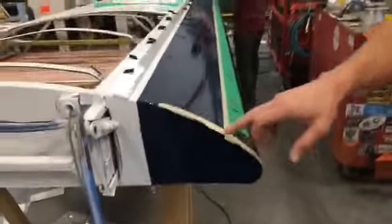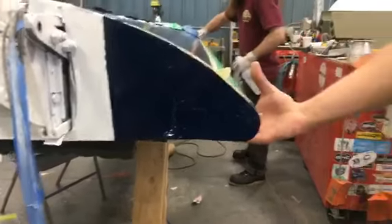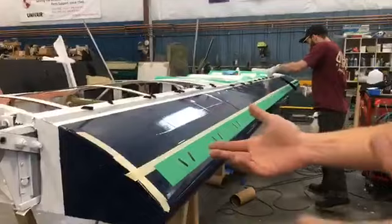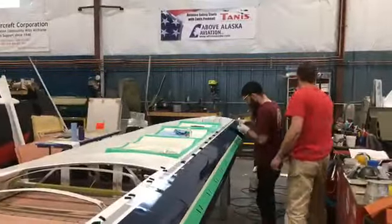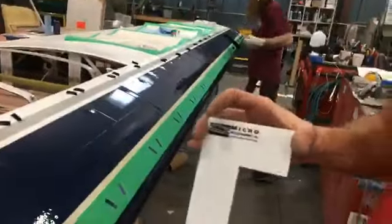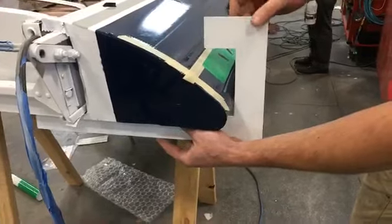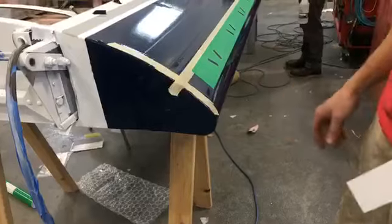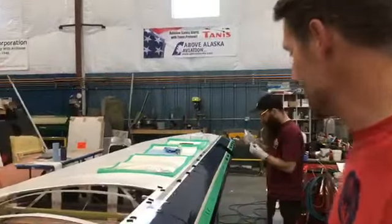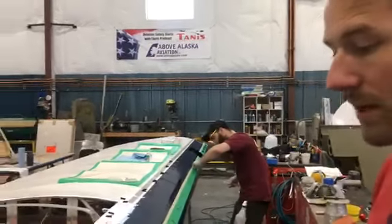These wings also have the crosswind STOL kit. The leading edge is typically here, but they have an extension on the leading edge that slightly droops it. When you put vortex generators on, you just put them on the way you normally would. This little jig comes with the kit — you put it on the wing and it tells you where to make your marks. Without the drooped leading edge they'd be back here, but you bring them down the leading edge. Charlie Center and Crosswind STOL sponsored the leading edge kit. There'll also be a big stall fence down the top of the wing and a small piece out on the wing tip, but those are in primer and still need to be painted.